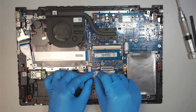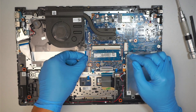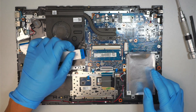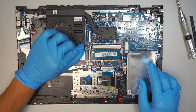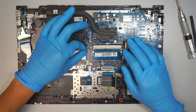This is your trackpad — open up the clipper and slide that cable down. Then flip the clipper up and slide the cable to your left. That is for your USB port, the I/O board on your left-hand side. This is your CPU fan connector — push it to your left and slide it to your left. That's how you disconnect the CPU fan.